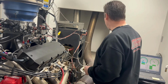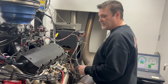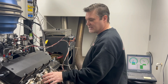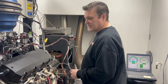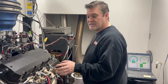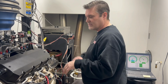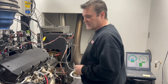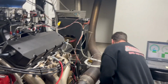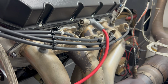This will spark, and then I can hit my nitrous button and you'll see the timing retard. But I'm going to show you how intense the spark is when I turn the RPM. A lot of people don't realize how intense the spark is, and this is why you never want to get shocked by high energy ignition, like if you're messing with this and you're turning your distributor, because this is what you're going to get shocked with. So I'm going to turn this on down here. Oop. The wire came off.